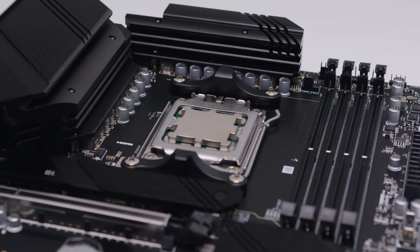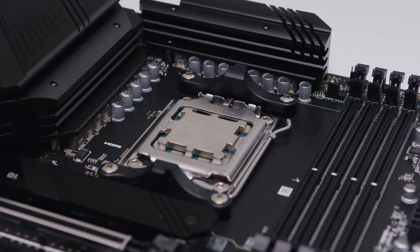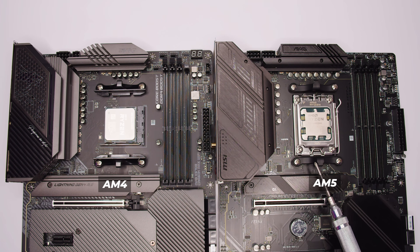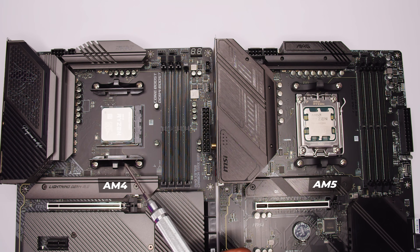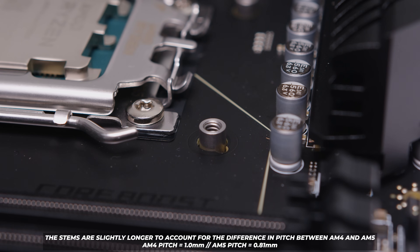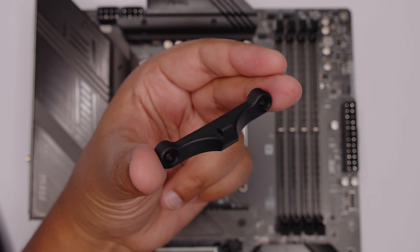This is mostly good news — if you're using a lower end chip with something like a stock AM4 cooler for testing, or you've got something like a Wraith Prism, you can mount it quite easily. The hole spacing between AM4 and AM5 is exactly the same. The main difference is that the backplate doesn't fall away from the motherboard at all, and it actually retains the same height as a properly attached AM4 backplate to maintain cooler compatibility. AMD has done well to retain this whole mounting solution.